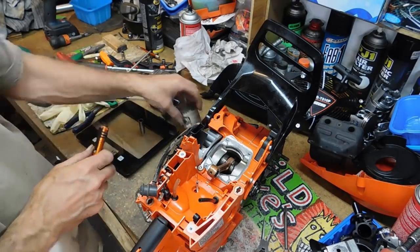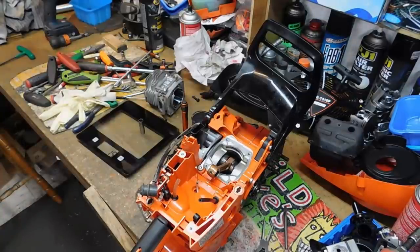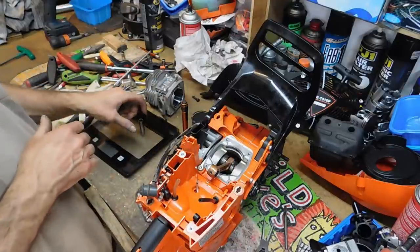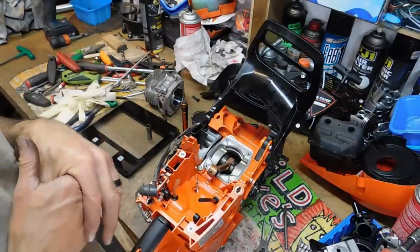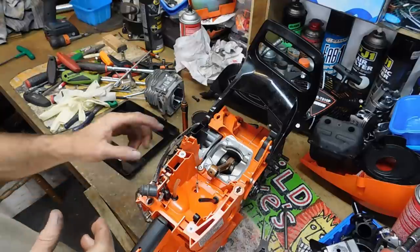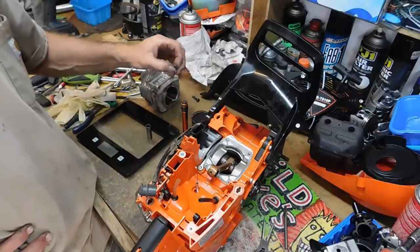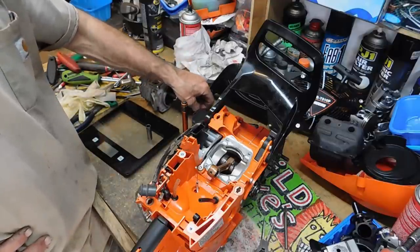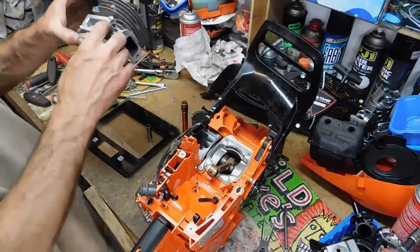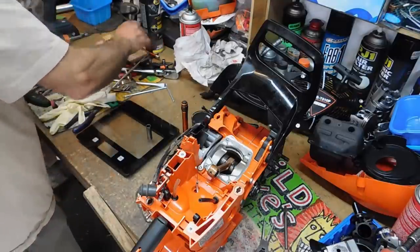There's a kind of weird casting flaw on the back side of the pin boss — it almost looks like the pin went in at a diagonal and is open on one side, which is unusual since they're normally captive. It's pretty rough in there and it's heavy, but I think it's got potential. We've managed to get her torn down and talked about a few things. The squish is huge — probably the major reason this saw is struggling so badly at elevation. I don't see any way this saw could ever run with some of the others out there without being heavily altered.